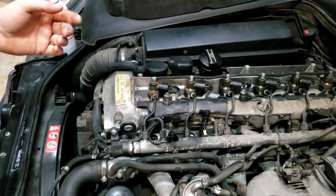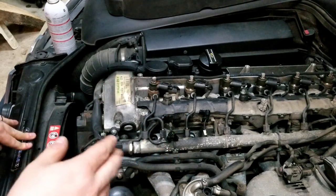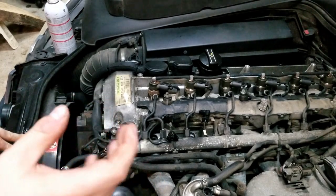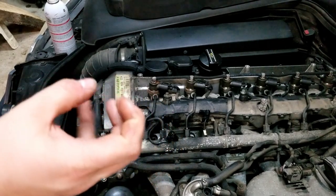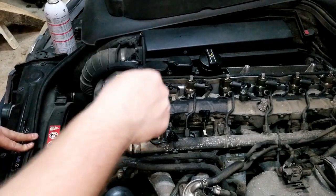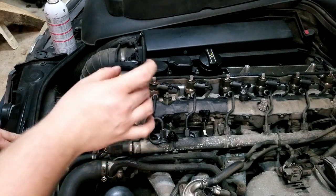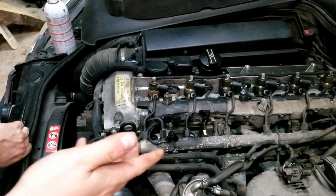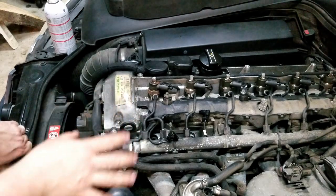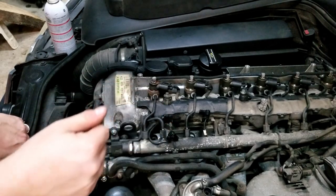On my own car I had coking on a couple of glow plugs. To deal with that, I take one of the old glow plugs, soak it in Fluid Film — a lanolin-based product that cleans and is also sticky — so when it cleans the carbon away it adheres to the plug. Then I use the impact to run it up and down through the threads, cleaning carbon out even down by the tip. After a few passes, I run a rag with brake cleaner down there as far as possible to clean out all the fluid film and carbon.